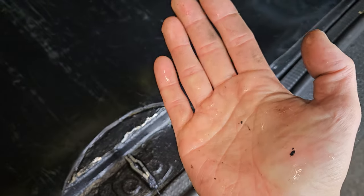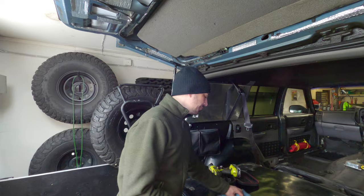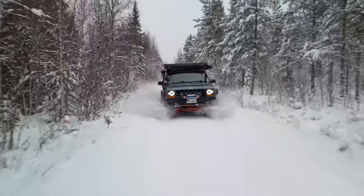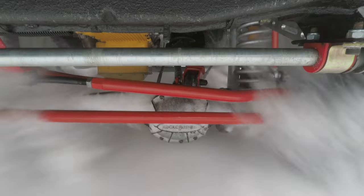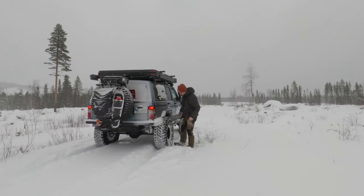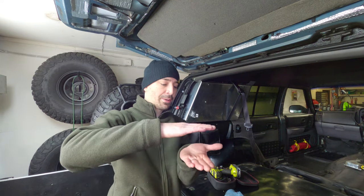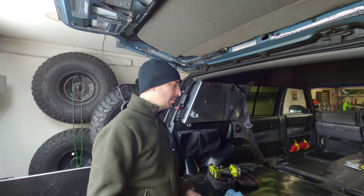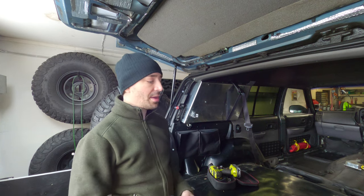Yep, lots of it. If that comes as a shock to some people out there, it shouldn't. Being in a cold climate and the way I operate the vehicle, it's just condensation, basically — it's unable to escape. You really want breathable layers, to be honest, or layers that are completely bonded with no air gap to the metal, and then that way you wouldn't get that.